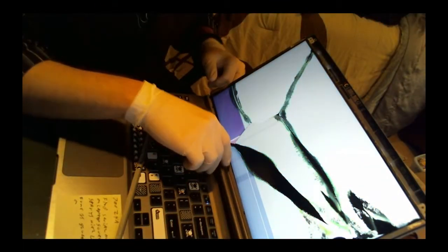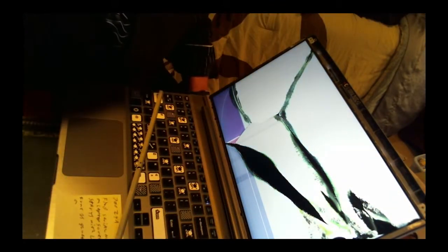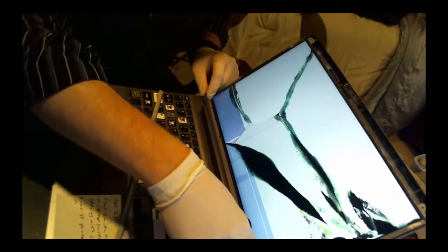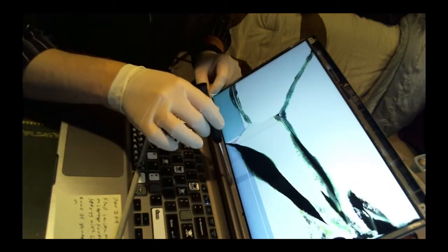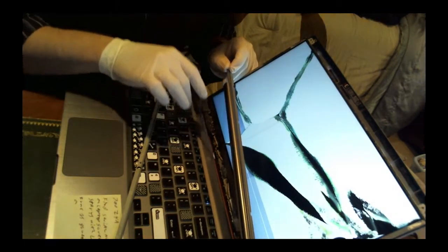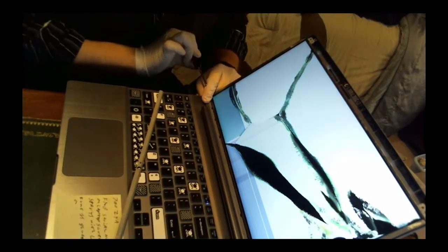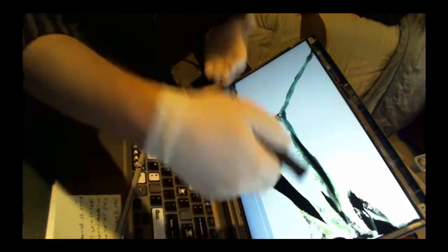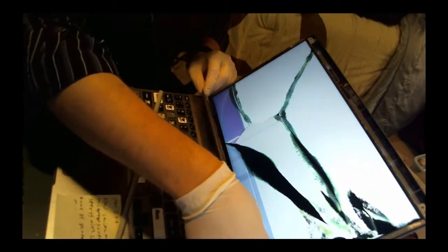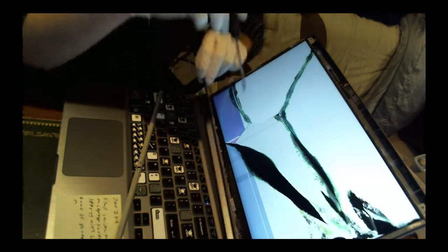So to get that, once you pop the friction hinges, you need to get a screwdriver. If I can find one. No. Great. I have to go get one. So once you got the friction hinges on top, these guys popped out. This part is a curved part, so it curves around over all the wires and casing down here. I took the screwdriver in this end and popped it out, and screwdriver on the other end and popped it out, and it pulled out this way from the laptop because it curves, as you can see from inside, all the way around the inside material here.